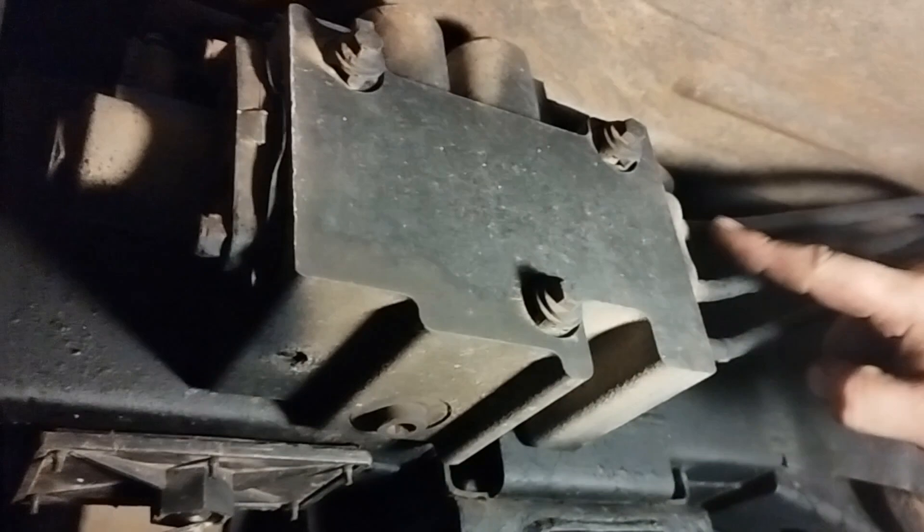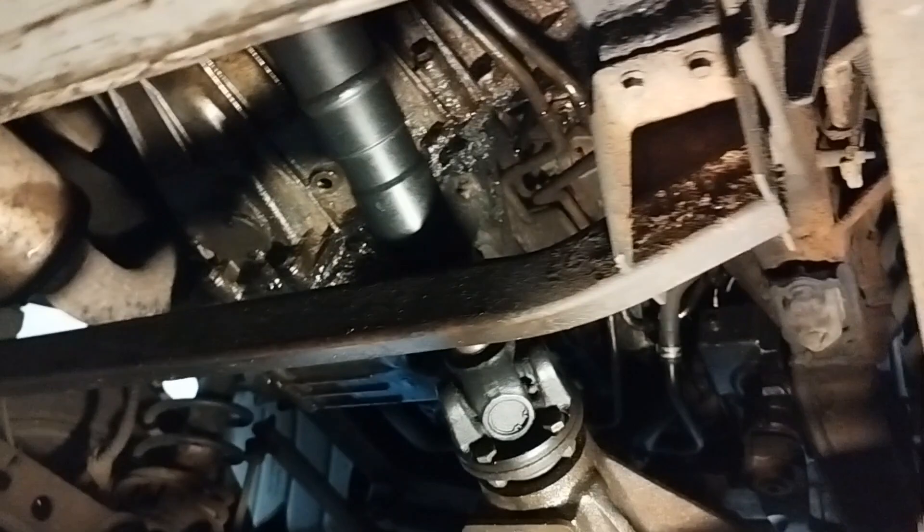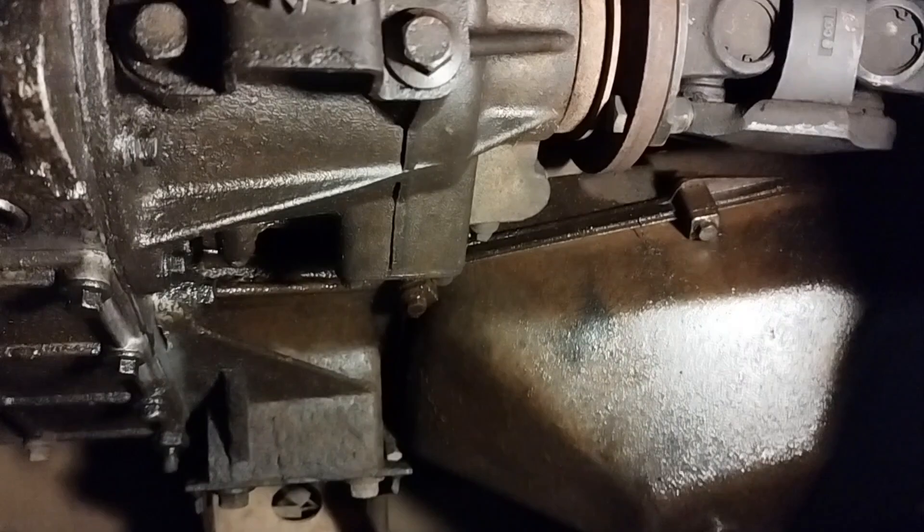Check the ACE pipes — make sure they're not rotting on these ends, because that's where they go. These have rotted on the other side but they can be blanked off. Check all your mounts for the steps — they're normally rotten. Check for leaks generally — it will have an oil leak, because it's a Land Rover. Check for diff leaks, and when you drive it, listen for a whine from the diffs. Rock on your prop shafts and make sure there's no movement in the universal joints — do that on both the front and the rear. Up there is the transfer box — check you've got no leaks coming from that.